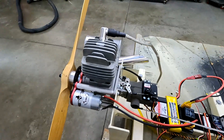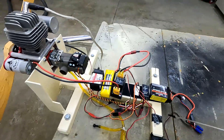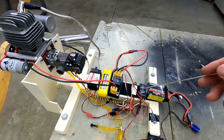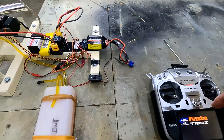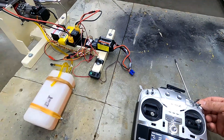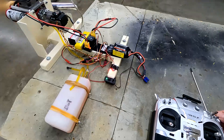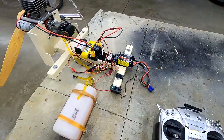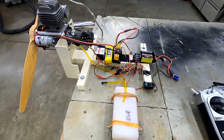Throttle servo here, air intake now comes in from the side. This is set up with one-switch operation using the EME starter relay and just a simple ignition switch. We go over the radio, turn it on, and with just a flip of the switch in one direction the starter relay comes on for a set time and shuts off — the motor keeps running. Shut the switch off and it's ready to restart again. There is a video coming on just for the starter setup itself.